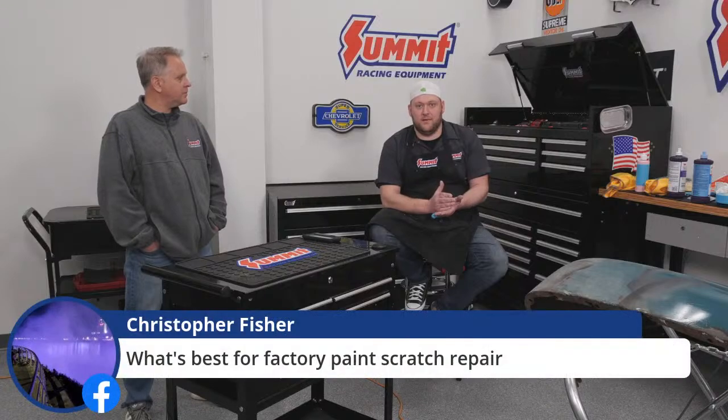It's just taking your time. A lot of it is just taking your time. Even on the front side with the body work, that's laying that foundation. It's just so much patience. That's exactly right. And 99% of a paint job is the body work and the wet sand and buff. There are some great painters out there that can lay down a heck of a paint job, but a lot of it is that beginning part to get it straight, and then the final part to get it flawless, to get the dirt out, to get the orange peel out, to get everything out.